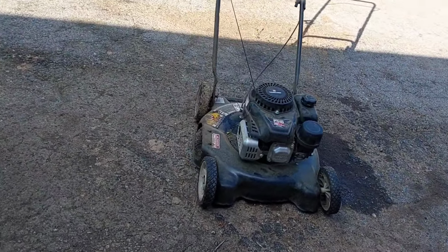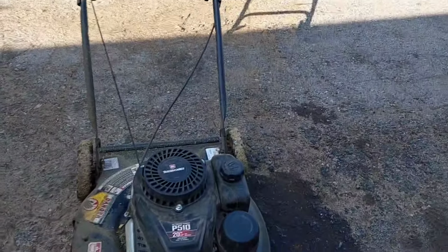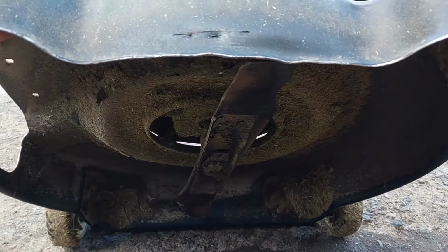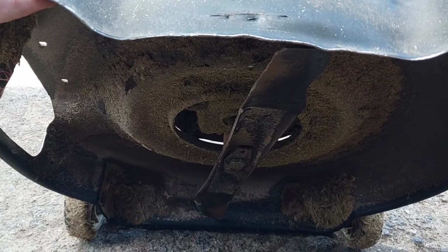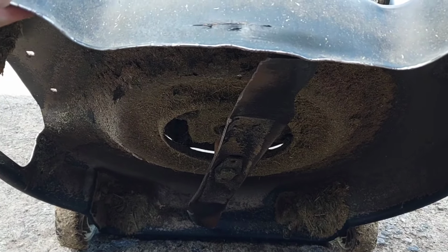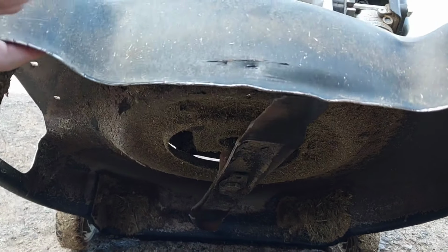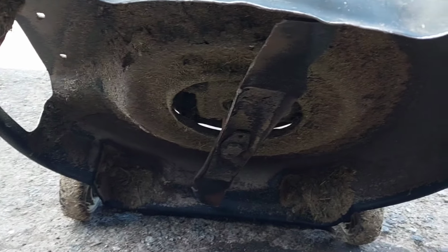Hopefully not that knocking kind of went away. I can't remember. I know I put another blade adapter on there, but I think I'm gonna clean that out, but I think I'm gonna put another washer on there just to brace it and see if that has something to do with it. I know that blade adapter was wallered out because of it. So drain the oil out next.